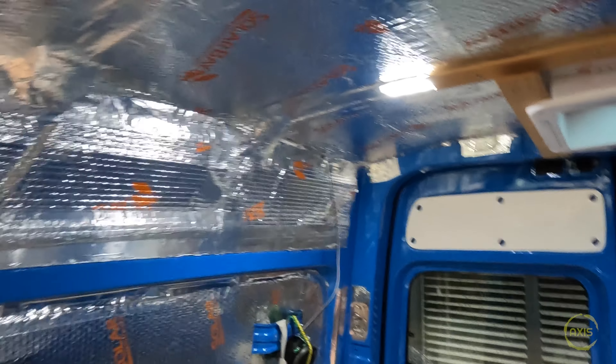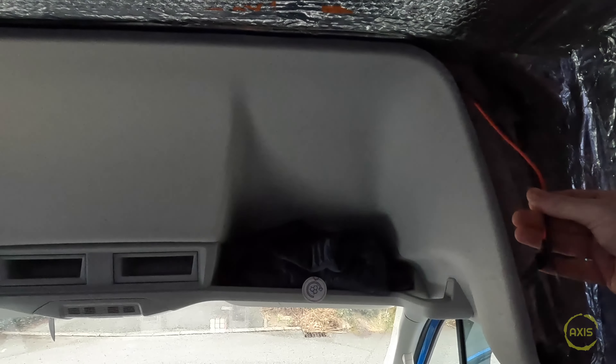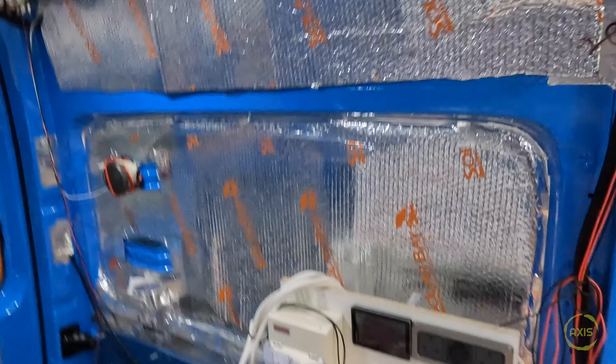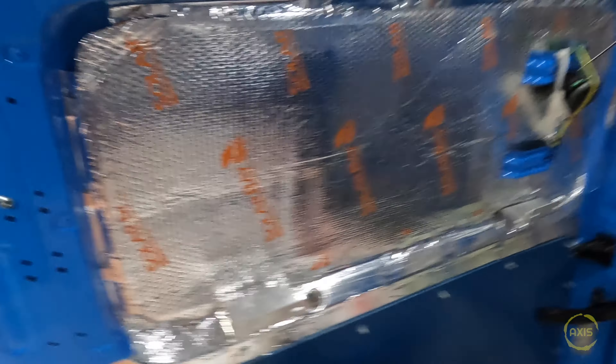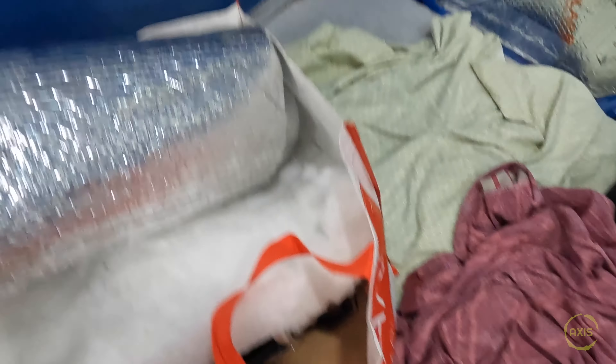The speakers - I don't know yet whether I'm going to put them in or not. Cable run up top, there's another one here that looks like TV cables or something - more speaker stuff. He's done quite a bit of the insulating but a lot of it I'm going to have to knock back as well because it sounds like it's been sound deadened but I need to check it, see what's underneath. It just looks like foil-back on that - I think I'll rip all that off, redo it, and put some sound deadening down. I've got bits here from my old conversion - just a bag of door sound deadening stuff. I've got a big roll of door liner, I think it was 12mm, in the garage - I'll have to dig that out.